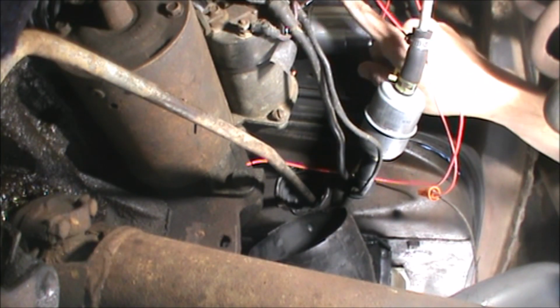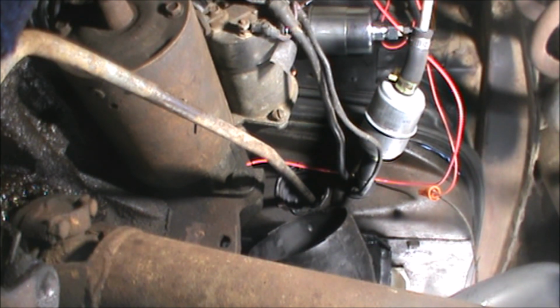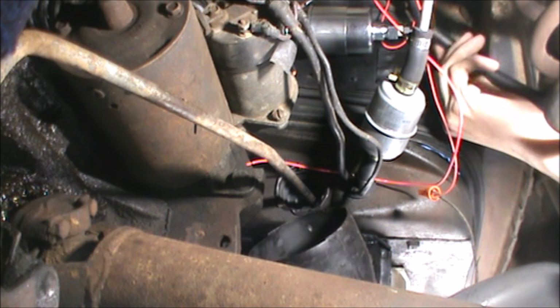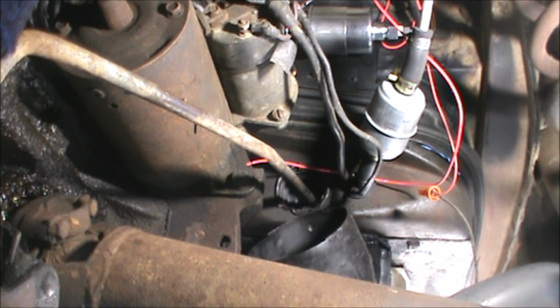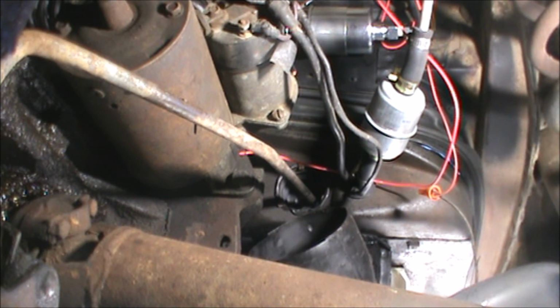Okay, so here is our pump. We're going to start by connecting the line to the inlet and outlet side. We are going to use some 5/16 fuel line. Whoop, got to put the clamps on there first. And I'm going to go ahead and just replace this section of line that is on my fuel filter, so it'll have passed through the filter and then the pump. Definitely prefer the other type of clamps, so I'm going to have to go in with my channel locks like this.